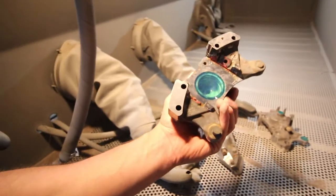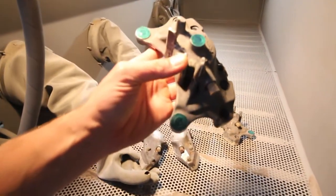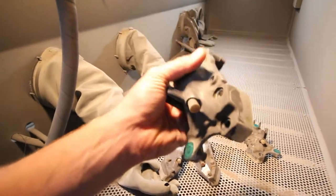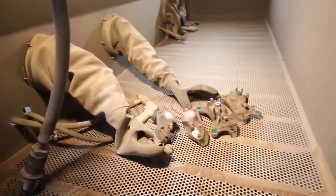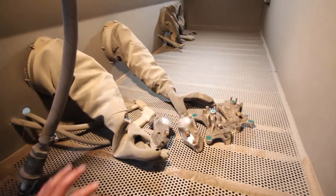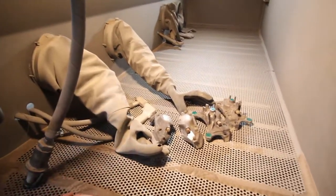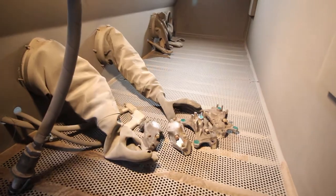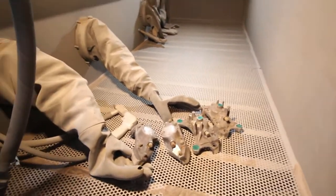And this is the other half. We try to tape it kind of like all the OEM finish would have. Brembo actually paints these things together as a whole. And this particular customer, Kenny, he decided that he wants to do it the same way. So we'll be coating the lines and everything as one assembled unit. And then we could put the caliper together as a whole.